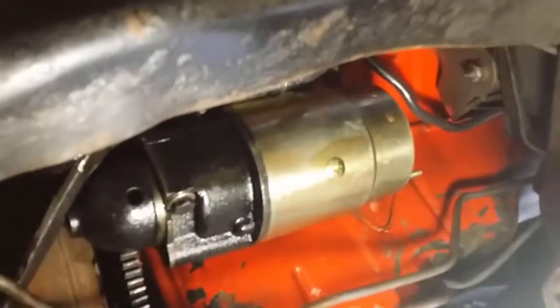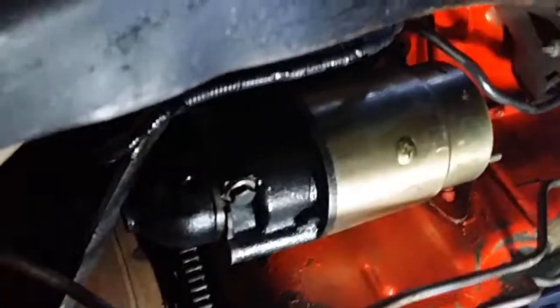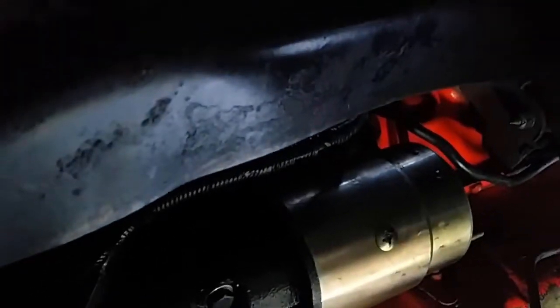Yeah, this is the awesome thing about having a truck. You've got stacks and stacks of room underneath. You might be able to see the clearance there. Okay, we'll get that starter motor off. It's fairly heavy, but there's only 2 bolts, one there, one behind. And remove some of the wiring and she'll come off.